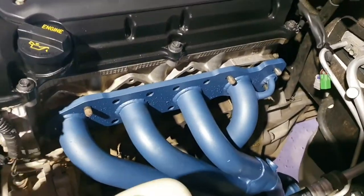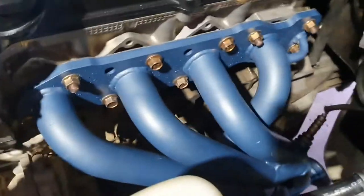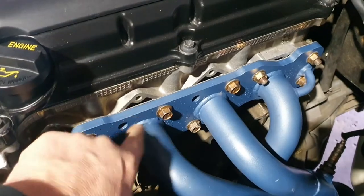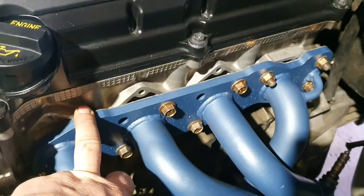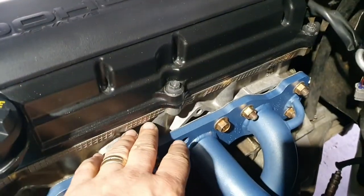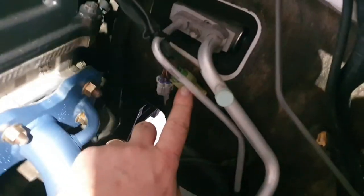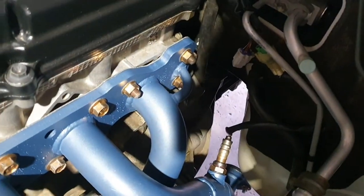Now I'm going to pull it off and we'll put a gasket in there, load up with some bolts and start moving on to the exhaust. I'm finished up top. Bolts are all in, new graphite gasket. We're using a header plate instead of a normal manifold, so the graphite has a little bit better sealing ability. I do like these and I would like to reuse it, but it's been used once so I'm a little bit cautious. It came with a nice new gasket - seems silly not to. O2's back in down here, clipped back into our loom, and that's for our secondary O2 which will go back in when we do the secondary cat.